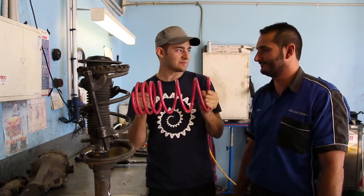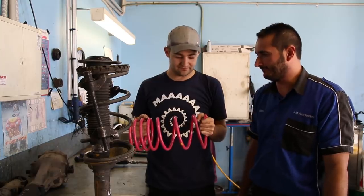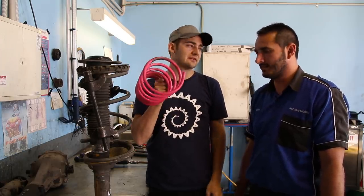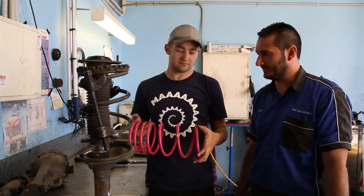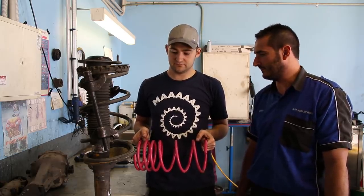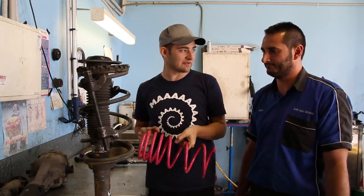The STI upgraded springs are there for a reason, so coupled together with some good Bilsteins will make a nice difference to Gramps. We're running a bit more weight in the front though, so we may have to change a few things in the back to match. The EZ36 obviously weighs quite a lot more than a standard GTB front end. We may find the STI springs will be good in the front and we may have to leave the standard GTB ones in the back - we'll swap them over and see. Spring compressors, compressor spring, top hat off, spring in, back on, let them up, put them in the car.